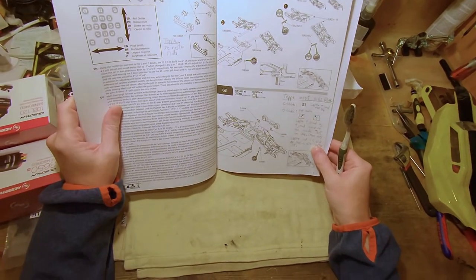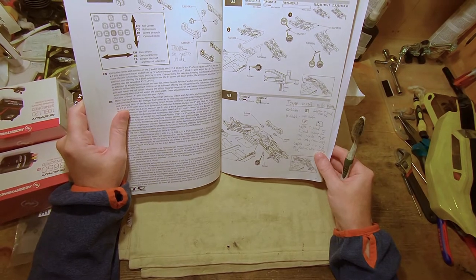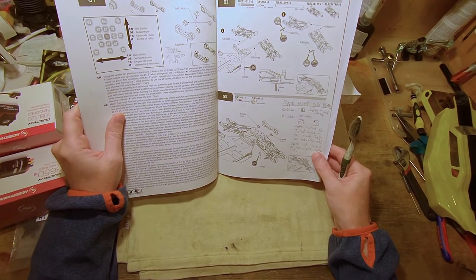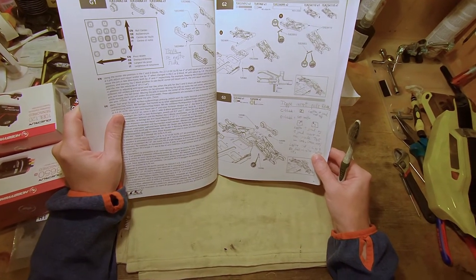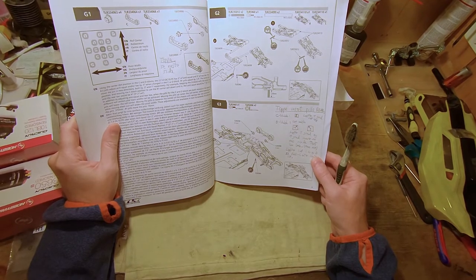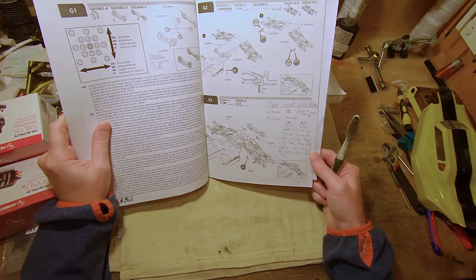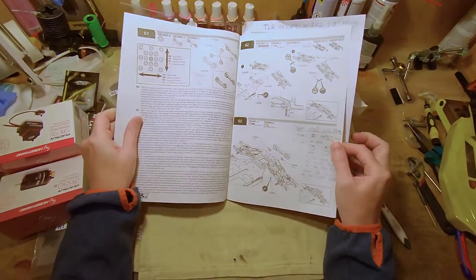So that's because I want the roll center to be a bit higher. That should keep the car from rolling so much on high traction ground. But that's just something I read, and I may be a bit wrong here. But that's also a change for the carpet setup.